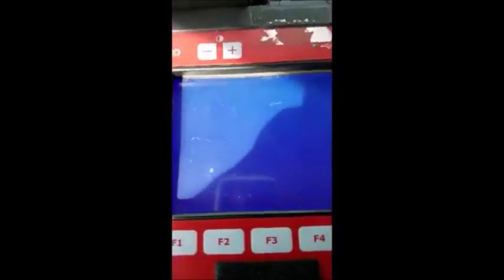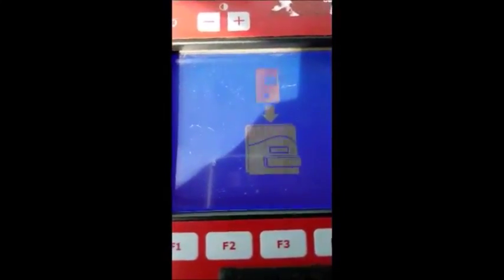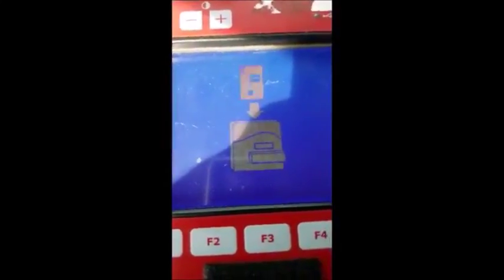So what we're going to do is select Infiniti, select North America by vehicle, and then we'll scroll to M45. Okay, we'll make the selection for 06 through 08. This is an 07. The Prox slot is the selection. And what will happen is it will come up with an ECU ID screen that will read the BCM number first. And there's our smart card calculation happening in the background by the smart dongle.